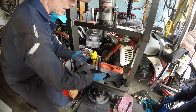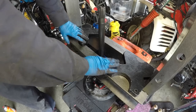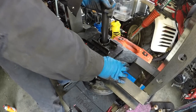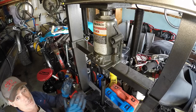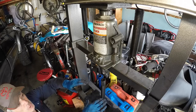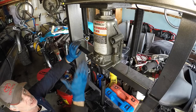Draw the axle up through and capture it with the press plates — a big notch forming a triangle captures the pipe of the tool. With the press plates pushed to the far sides, lift up the assembly and press one plate underneath, then the other, and now it's captured. We're at the fourth position because we couldn't go up one more notch without the axle already hitting. The bottle jack has a bar screw you can extend several inches to get more travel distance.